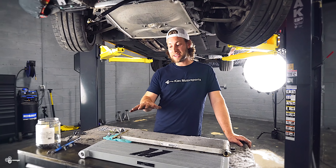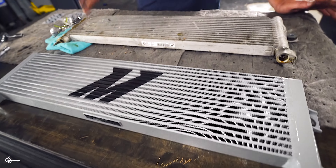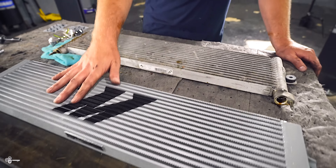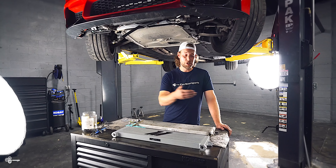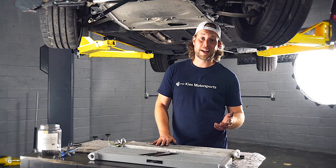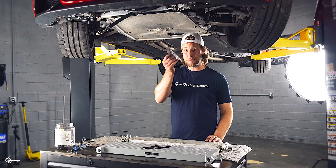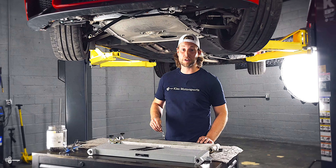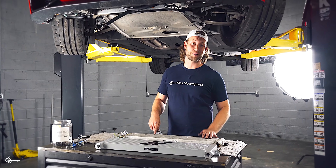You may be thinking this is larger — do you need to add more oil? The answer is absolutely yes. When you add this, you need to add 0.44 quarts of extra oil in addition to any that you may have lost. The last thing I want to mention is that it's direct plug-and-play, and they actually give you all the gaskets and little bolts that you'll need. With that, let's transfer over the grommets to the new one and install the Mishimoto.